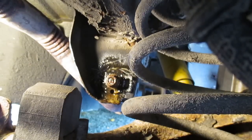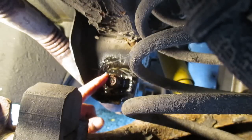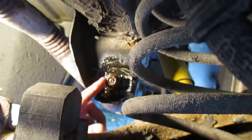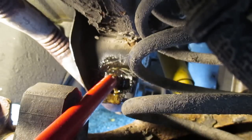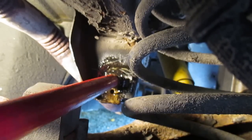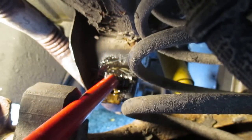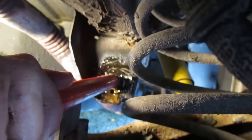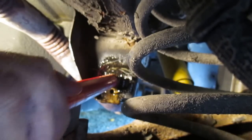I want to drive that bolt through, but I want to try to salvage it if I can. You can see I have the nut that came off — it's not really salvageable, it's all rusted, so there's no problem getting a replacement. But I don't want to damage the bolt. In a scenario like that, put the nut back on just as I have there. That way, we're going to pound on the nut instead of the bolt and potentially damage the threads. I have an old jack handle — I'll put that on there, give this a couple of hammer strikes, and we'll see what happens.